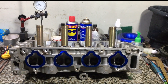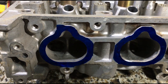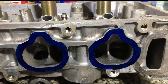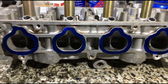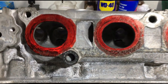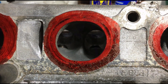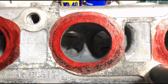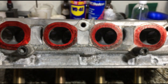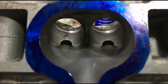Here's the PRB head — you can see the ports are stock and actually quite clean. It has way better core shift than even the B series, obviously because these are newer castings. When we compare to the B series and even the D series, here's the exhaust side, and we will talk about the core shifts and what we avoid touching.